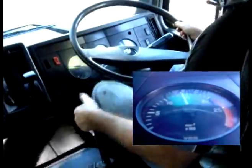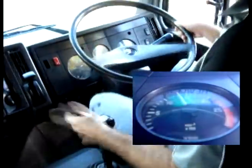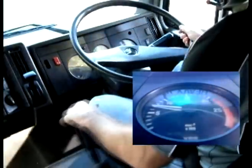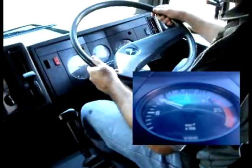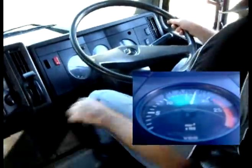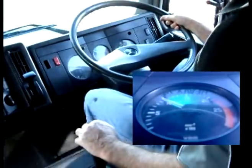OK, 3 to 4. And just to tell you that if you do miss a gear, we leave this range selector down. If we miss it, don't keep pushing. Just get the gear lined up, fix your problem, get off the clutch, give it a little rev — just about 1100 — into gear, get on with it. So just again, if you miss your gear — going to miss 6 deliberately. Get off the clutch, get the gear sorted out, get it lined up properly. Just a little rev, a little bit of clutch, into gear, and then just get on with it.